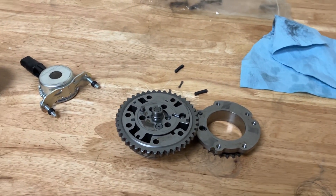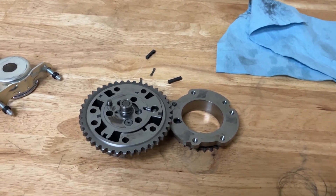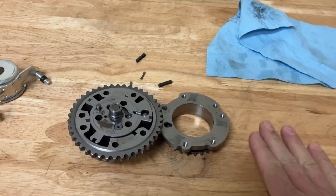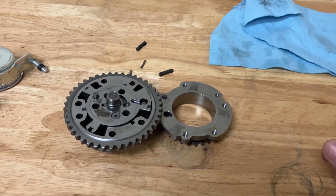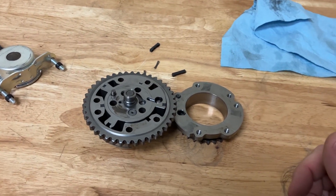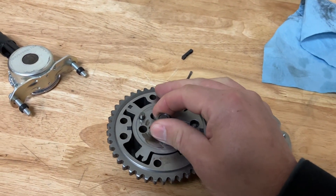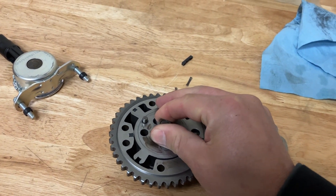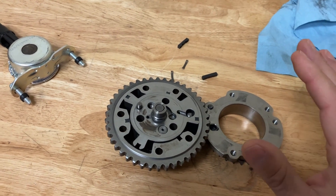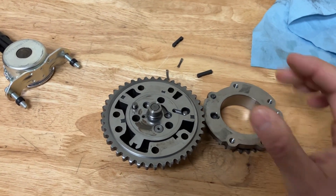If you have a standard eight-quart pan and you're at 8,000-plus RPM with no crank scraper, just a factory windage tray, you're going to pump all of the oil to the top of the engine. The problem is it's not draining from the head — it's all been used, it's come out of all the systems and it's just sitting in the top of the head. In the oil pan you have a bunch of air and oil foam mix, so the pump starts pumping that oil-air foam through the engine. You can have bearing issues, and then you get air in this chamber. Just like air in your brake system, that hydraulic system gets spongy and you start losing oil control. If you watch the camshaft duties in the data log you'll see these moving around. The ECU will say it's done, bleed off all pressure, physically lock the phaser and the camshaft, and throw a code.